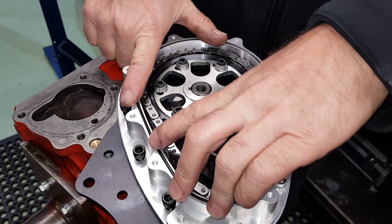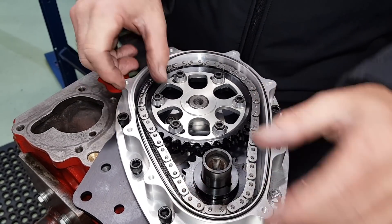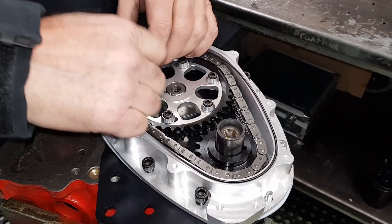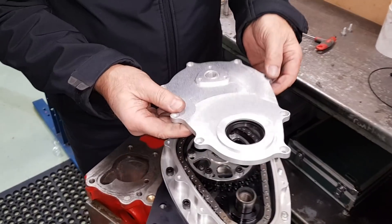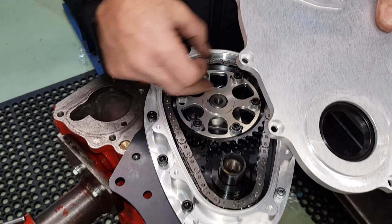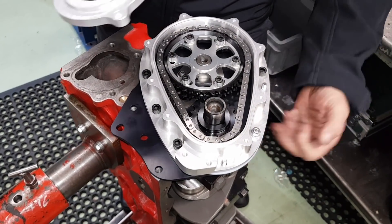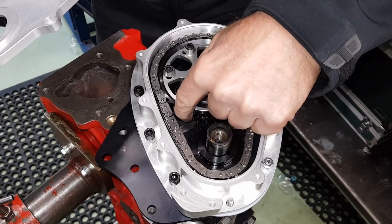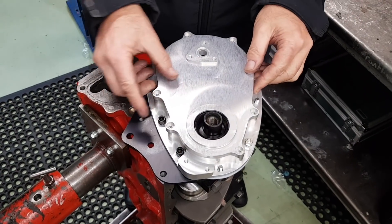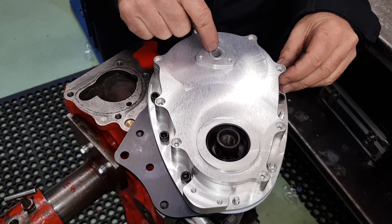Just run your fingers around — once you put a bit of grease on it, it will stay in position. Here's the lid. What you'll notice on here is we've put a hole in here. This is to relieve the pressure from inside here, which is created from the pressure inside the crankcase which comes up through the hole there into here. The O-ring has sealed it but you've got pressure in there — this will relieve the pressure to atmosphere.